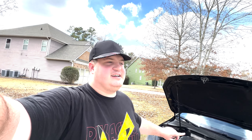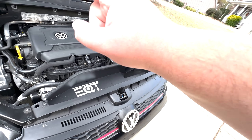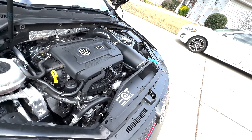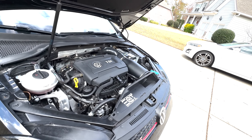Now for the good stuff. In that same email, Matt said the duty cycle is still a little higher than he'd like — but if I'm ready to turn it up, he'll turn it up and we'll see what happens. I gave him the go-ahead to write the first revision for this car, which means I'm finally getting off the base map after a couple of months of chasing this duty cycle issue. We're still not totally out of the woods, and it's honestly nerve-wracking — I don't want to pop this motor or this turbo.